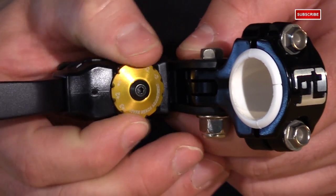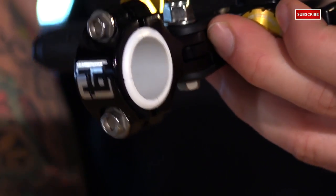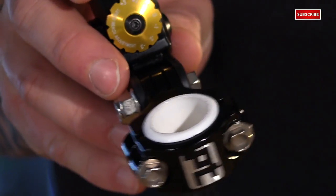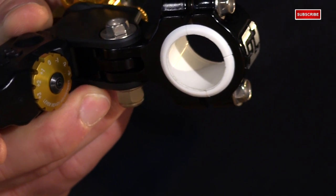Just inside, you have the lever reach adjustment, so this is going to accommodate many different types of riders. This white part here is a plastic bar sleeve, so this is going to allow the assembly to rotate in the event of a crash rather than break off.